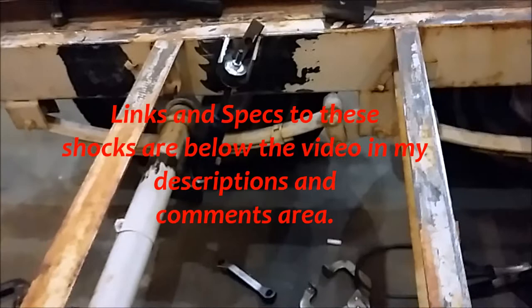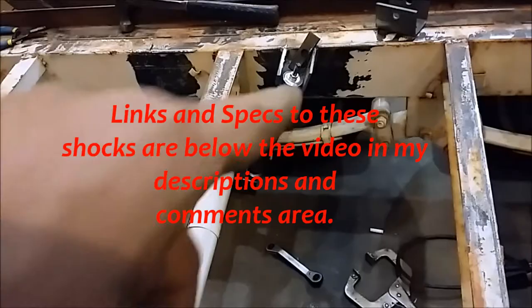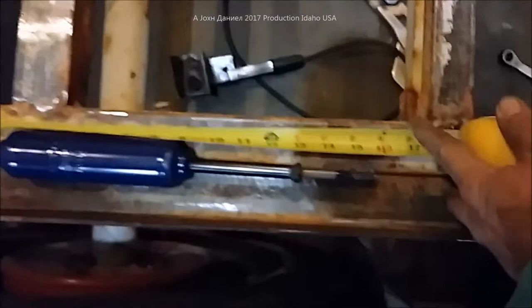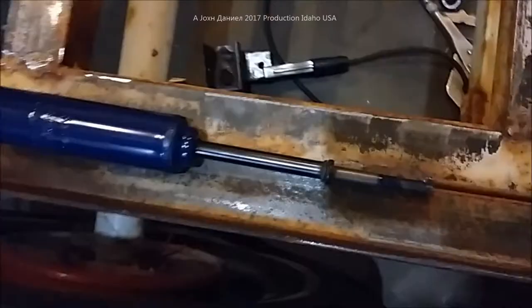For your average little flatbed trailer, you can use this on cargo trailers and box trailers. I've already put the link down there for where I got these, or the Gabriel equivalents of them. Let me measure these to show you what you're working with in terms of travel. The total length of this shock is 15 and seven-eighths inches, point to point. You want to make sure the shock is traveling downward a little before you install it, so don't make your spacing exactly that length.